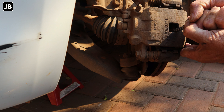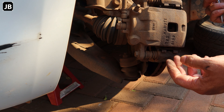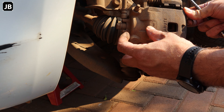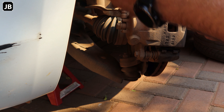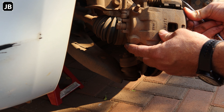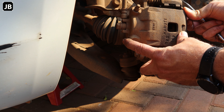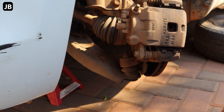You need to compress the slave cylinder a little bit, otherwise you're going to battle to get the caliper off the rotor. I put a little pry bar into the vent hole over the rotor and just jammed it open, so I can pry that cylinder a little bit to get the caliper off the lip.